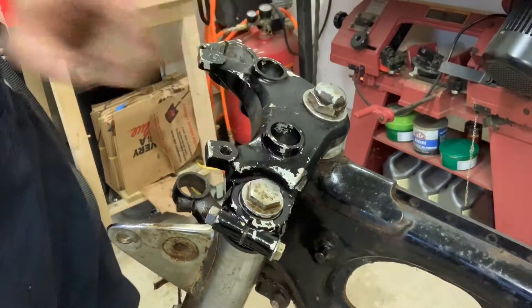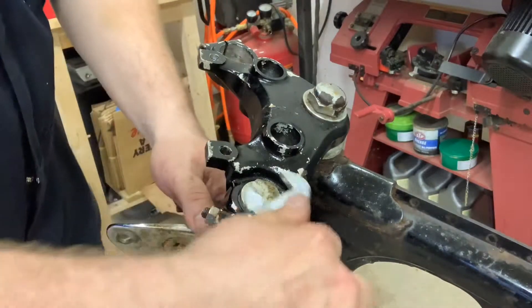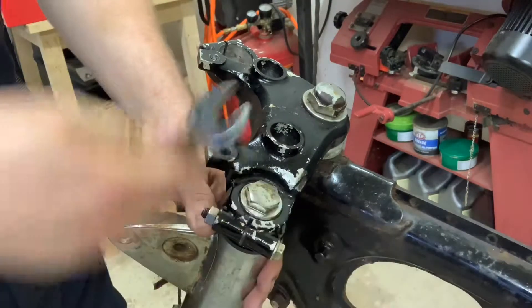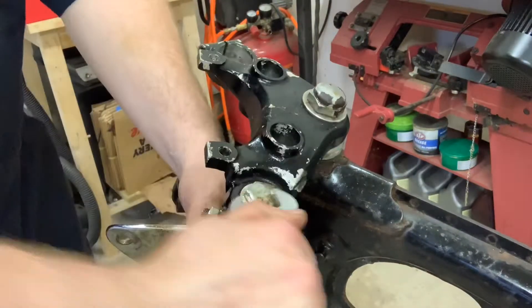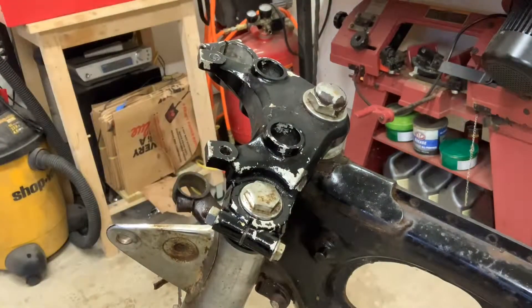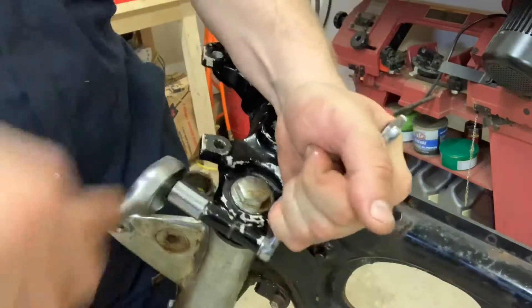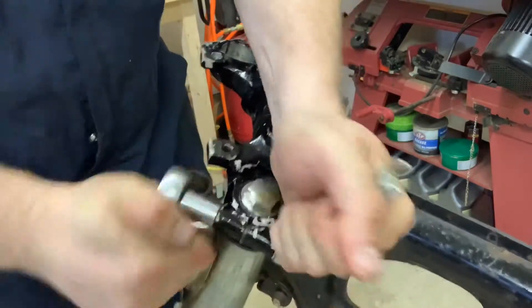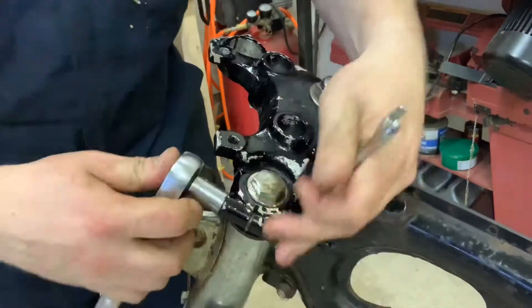So we loosened these in order to drain the forks, but in order to get it out, I'm going to recommend that you tighten this bad boy back up, because it's going to take just a little bit of abuse here in just a little while. These are supposed to pull straight down and out — that did not happen. So I'm going to tighten this back up. You're going to need a 12-millimeter wrench and a 12-millimeter socket, and you're going to take off this top bolt. You can just feel how crusty this is already, but it's coming out.